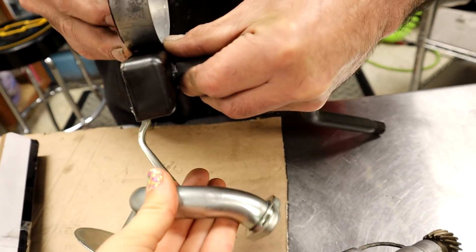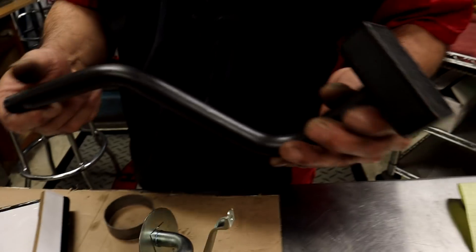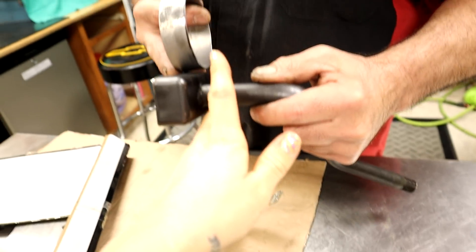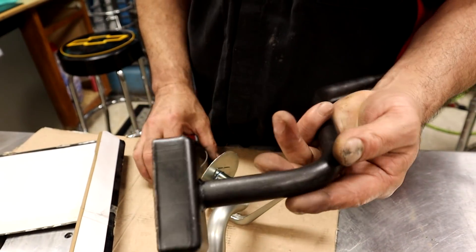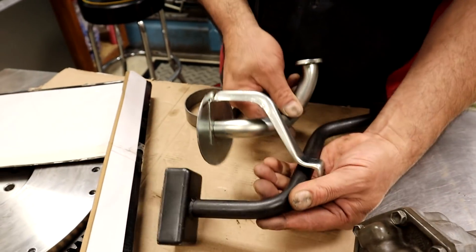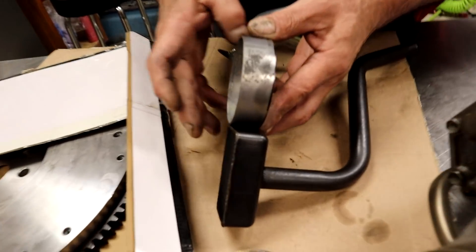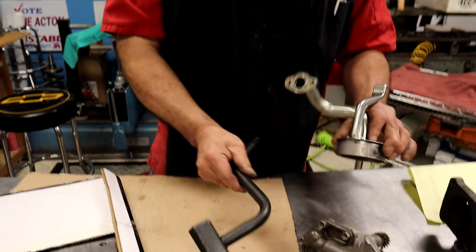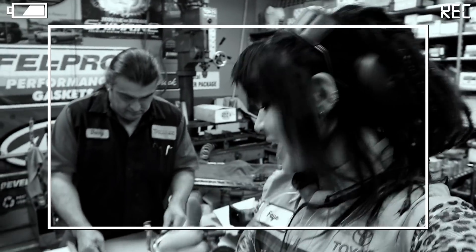This is for a much larger engine — a Toyota 7M versus a 440 Dodge race motor. You can see the volume is there. Is this a low-pressure, high-volume system? This is high-pressure, high-volume — it's a race motor. Real high-pressure, real high-volume, a 440 Chrysler spinning up high RPMs. This is a Moroso piece, a nice piece, not a factory piece. There's no way we're going to starve this motor. And this is exactly what so many people have been asking about — what upgrades am I going to do to make sure the factory 7M is still good? This is one of them. We all hear that rod knock is really common in the 7M — probably because people just run low on oil. But this is going to help prevent that from happening.